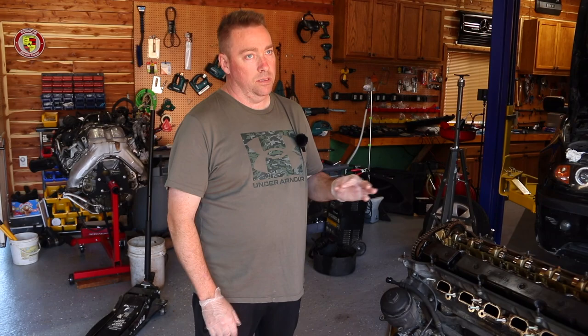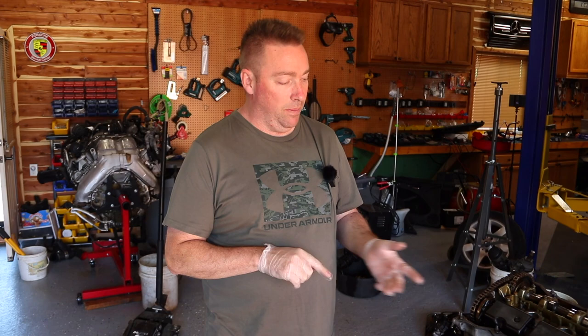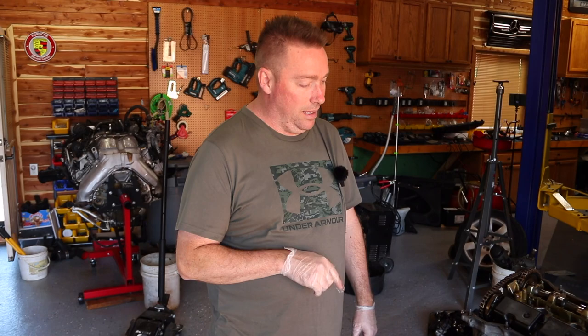I've never had one of these that had a Vanos rattle that new O-rings didn't fix, never. I've probably rebuilt, I don't know how many Vanos, a lot. And if you're having rattling problems, usually it's something else, to be totally honest with you.